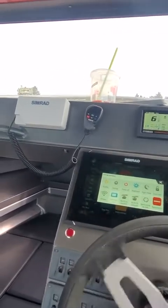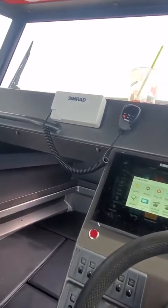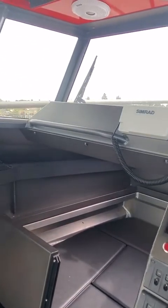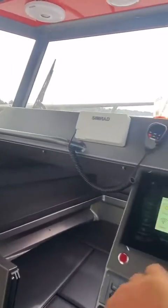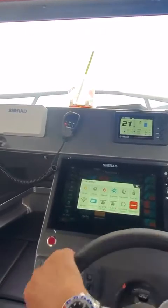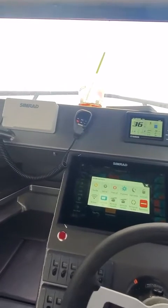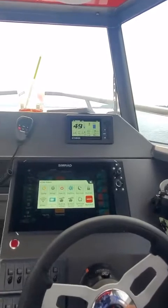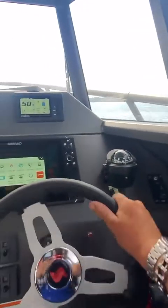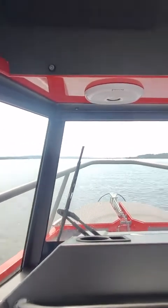I'm going to hit this thing right here — that vibration's just because of the stainless prop. I'm going to hit it right here just so you can see. See how I'm kind of straight now? I got a little lean to the right, but as soon as I give it some gas it straightens out a little bit. I'm going to trim it right here so it lays a little bit — not much. What I would say is: trim tabs.